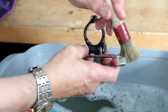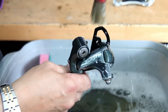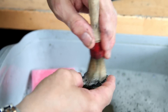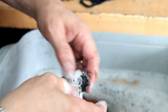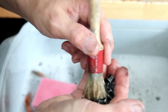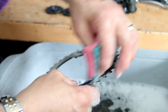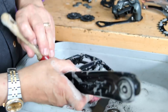Look at this front derailleur — it's been through the ultrasonic cleaner then washed down and come up like new. Even this rear derailleur, when you think how debris-ridden it was and how many miles this bike has done — thousands of miles — cleaning those parts up, the parts that aren't wear parts, the actual cogs themselves come up lovely. All the parts we needed to clean have gone through the ultrasonic cleaner. Even this spoke protector we've washed down, and the small chain ring and pedal arms — all cleaning up nicely and gradually we get this bike ready for the rebuild.